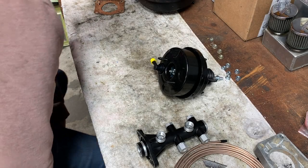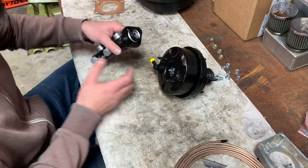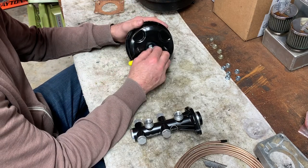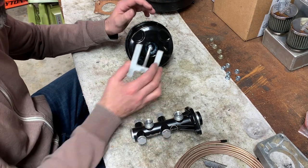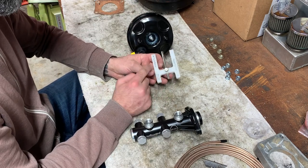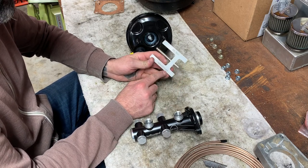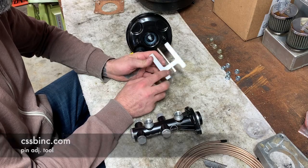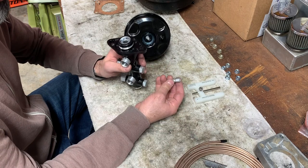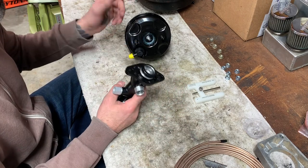All right, guys, let's go ahead and mount this master cylinder to our brake booster so we're not fumbling around in the car trying to figure things out. I want to show you guys how to adjust this adjuster screw. This is a tool I found online that makes your life way easier. It's clearly marked what you need to do. This is where it's from. I'll post a link below so you can go get it. It's pretty good. This kit is kind of universal, so they supply this little flat one here. You just stick it in there, and then you can use different applications.